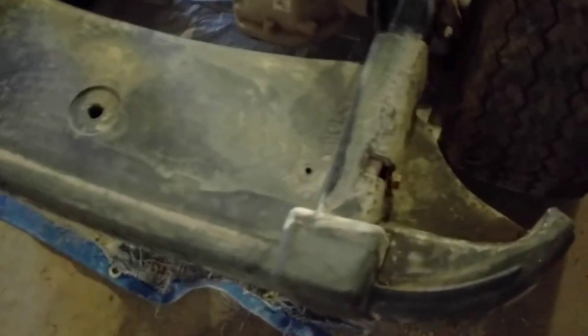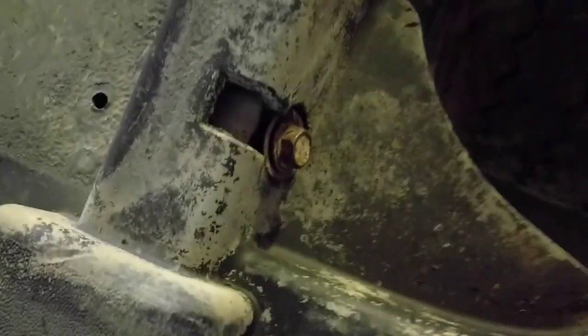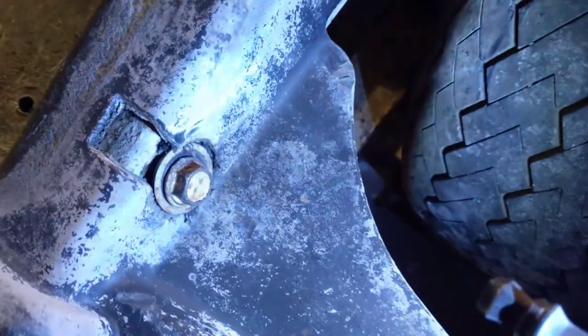As you saw in the last time-lapse, I've been trying to remove this screw right here. I used my drill to give it a bit of light there and it is just not coming out. What's happened is there's a bolt that's been welded onto the frame that the screw goes into, but that weld has pretty much broken over time. Basically, the bolt is rusted onto the screw and the screw is not coming out — it's just spinning pretty much freely. I've been trying to use the washer to grind down the plastic, but the bumper isn't coming out. I'm just going to have to go buy an angle grinder and chop off the bolt.